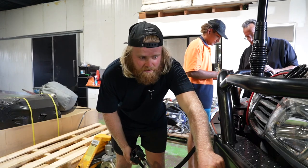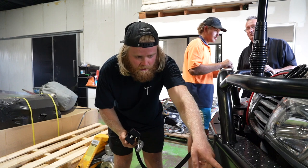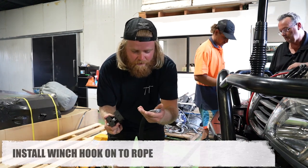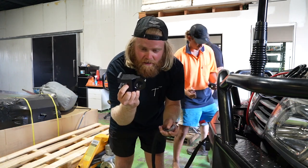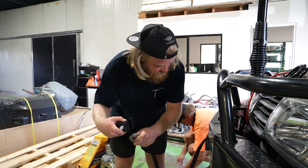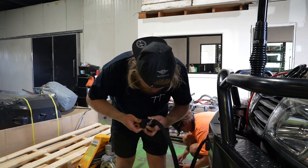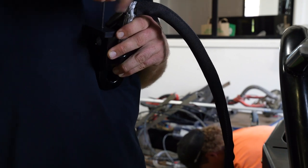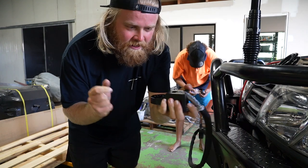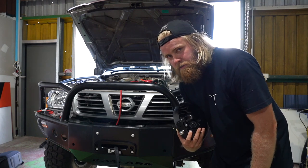Mounted those indicators and parkers on the side of the bull bar there — you just sort of have to do a few bits and pieces once it's actually on. Still got to wire them up. I'm going to do the winch hook now. It turns out it comes with a closed hook system — these are really cool. Just undo your grub screw, pull your pin out and then you can put that in and that'll be your winch hook. Once we've got it running, you'll just be able to wind it back in and that'll sit up against your fairlead there. Zach's just doing the isolator switch for the winch now — that needs to get mounted up in the engine bay. The isolator switch is for isolated power on and off.